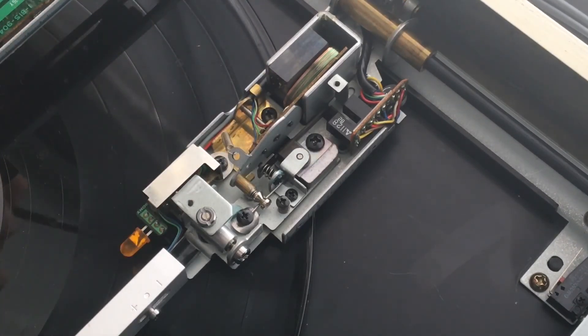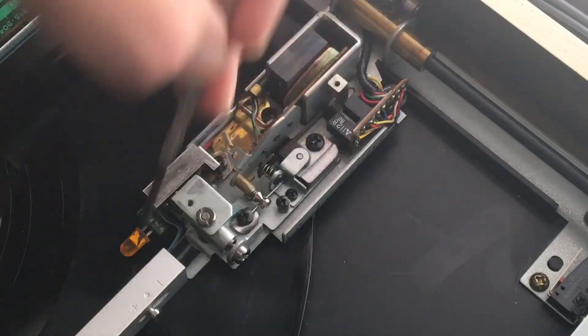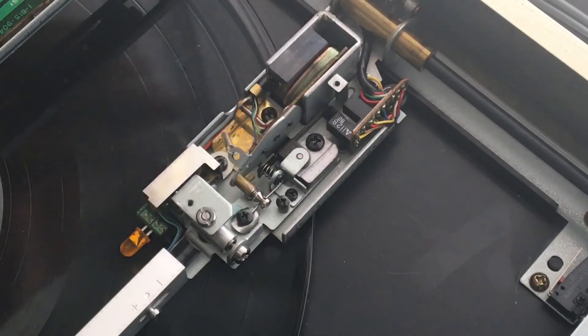So these operate a lot differently. The biggest thing to take away is this optical sensor and this blade right here — that is key to get situated so that the timing is correct, and the whole chassis as one unit moves along this guide properly while still allowing the arm to free float. That's all we have for today. I'll see you on the flip side.